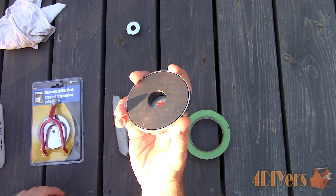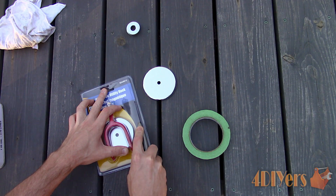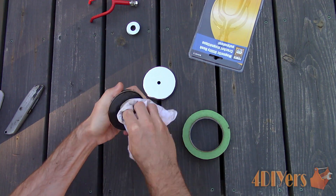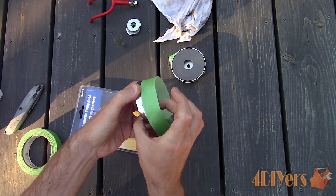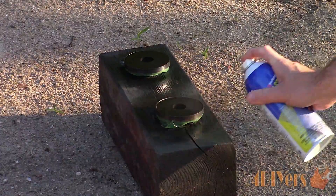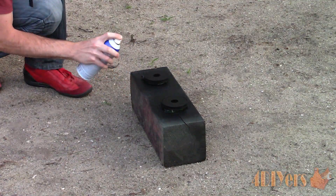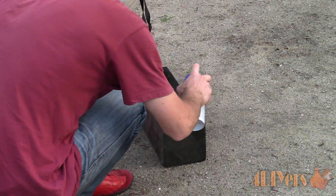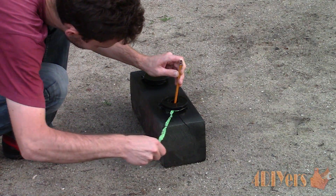In between my wiring I prepared these magnets so the coating would have time to dry. These magnetic bases were originally intended for a hook mount and are rated for about 10 pounds each. Give them a wipe down with a wax and grease remover — this will ensure the coating will stick with no peeling issues. Apply tape if you wish, then another wipe down with wax and grease remover. Now on to the coating. For this I am using plastic dip; you could also apply a vinyl coating, felt pad, rubber pad, or some form of protection to prevent the vehicle's paint from being scratched when these are mounted. I would recommend at least three coats to provide that cushion so when the magnet is attached to the paint it won't damage it. You will also need to be careful when installing the magnets onto the metal — if it snaps into place you may risk denting the surface. While the plastic dip is wet, remove the tape and allow it to dry.